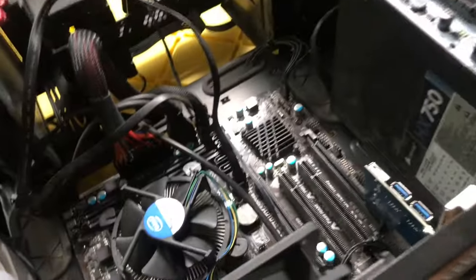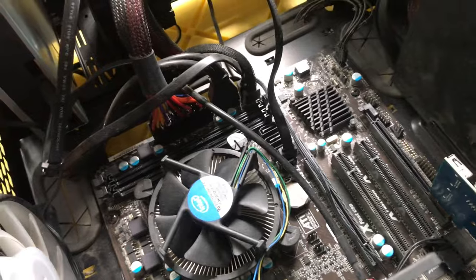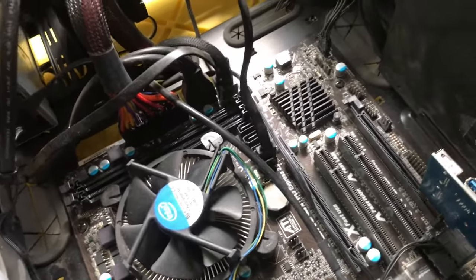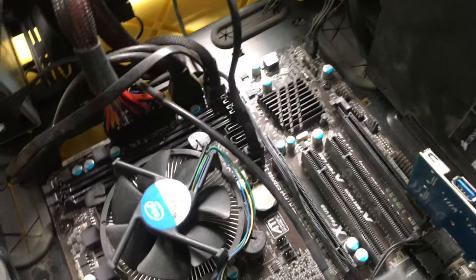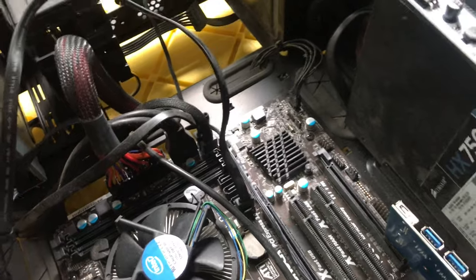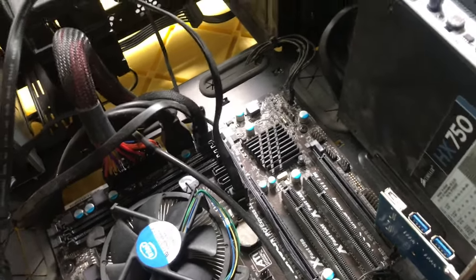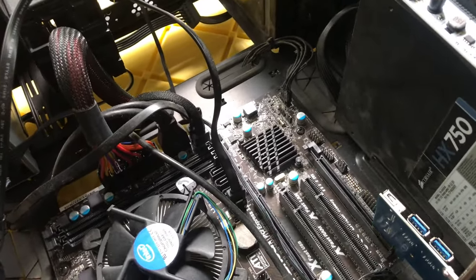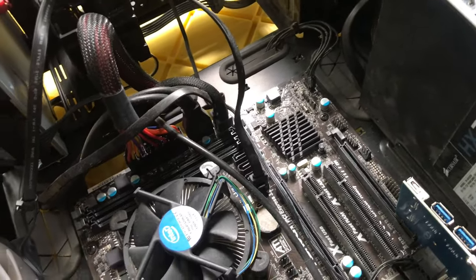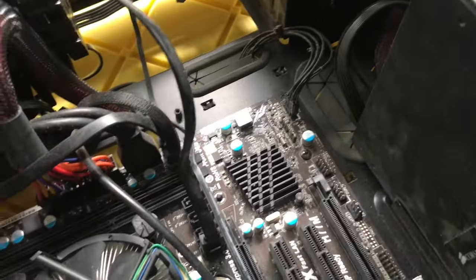So that's how you do it. That's how you get multiple GPUs off a motherboard. This is an old motherboard and it worked great. ASRock for the win. No issues at all. Some of the MSI motherboards, I had to go in and tweak the BIOS settings just so it would pick up and recognize 3 or more GPUs on the motherboard. It was a pain in the butt, a lot of trial and error, a lot of reconfiguration. Just learn, try, try, try.